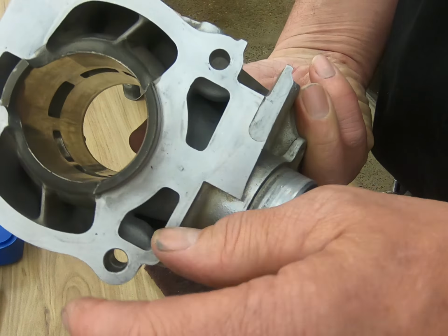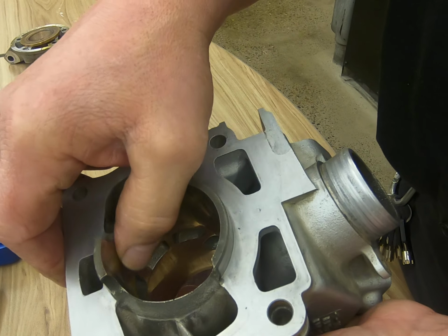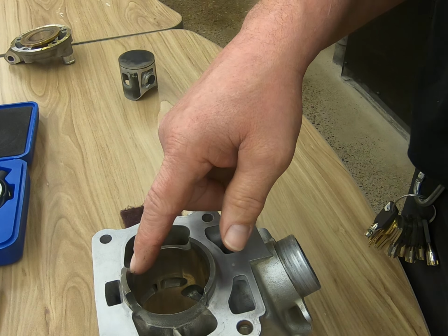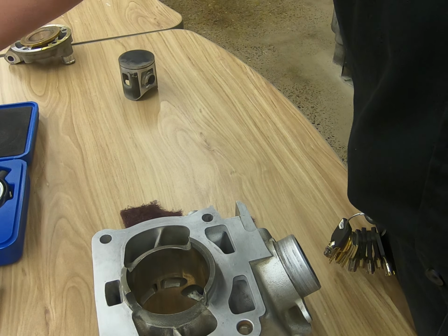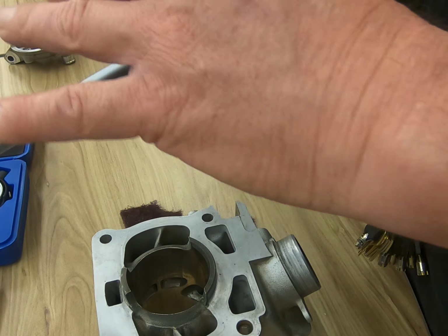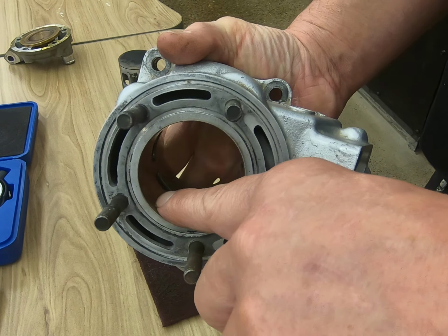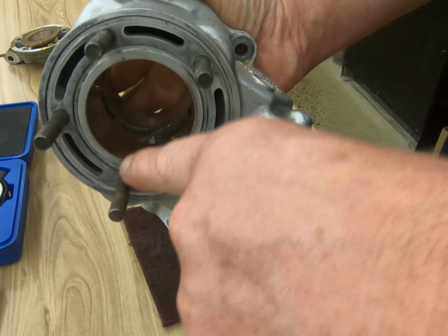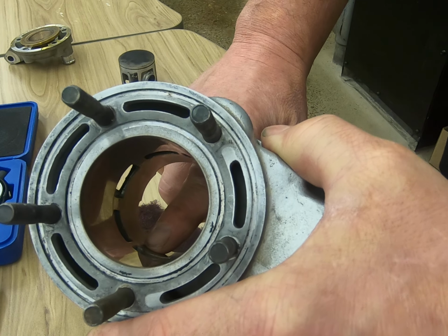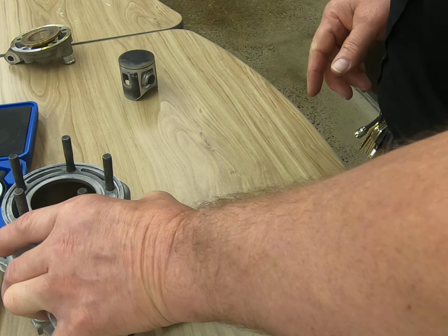Further inspection, you want to look at the bore. Make sure that it's clean, make sure that it's not all scratched up. And we're going to use T gauges, or we can use our bore gauge, and we're going to go down through and measure the bore. On a two-cycle engine, it's typically at 4 levels. All the way at the top, just above the porting, just below the porting, and down at the bottom. Now we're checking for 2 things here.